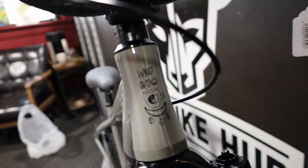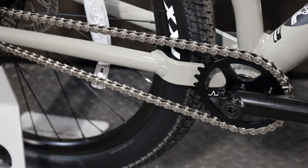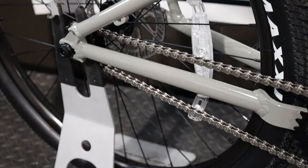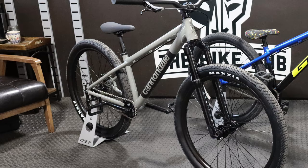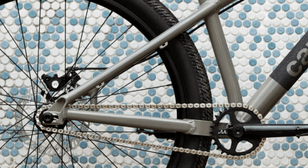At the bottom of the frame, the Dave is equipped with an 8-spline 3-piece crankset in a threaded Euro bottom bracket on a 19mm spindle. The cranks turn a 28-tooth sprocket up front and a 13-tooth cog in the rear. This will give you a balanced pedaling platform that's not too hard and not too spinny. The wheelset is made up of 32-hole double wall rims laced to a Formula 20x110mm front hub and a sealed bearing cassette driver hub in the rear.